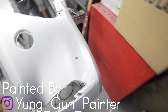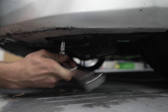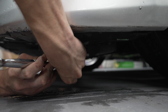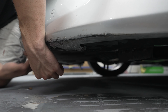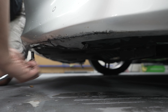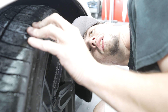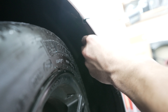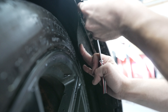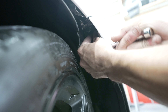I need to get a bumper guard — this is my new front bumper, all painted and good looking. There's going to be a series of 10 millimeter bolts underneath here, and you can see the everyday wear. We're going to take all these 10 millimeter bolts along the bottom off. There are also some flat-head-looking ones behind the front fender, and two 10 millimeters up there as well.